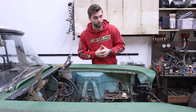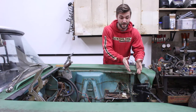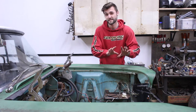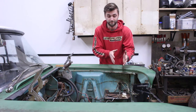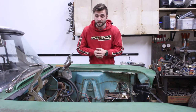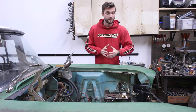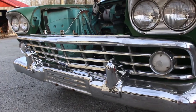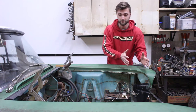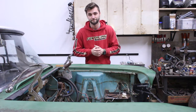We also have to run an intercooler because we don't trust doing burnouts in this thing with no intercooler. So we've got to try to get the intercooler as close as possible to the front of the grille, then get a radiator in without hitting the balancer on the 12-valve. We're going to run electric fans on the side so we can bring the radiator as close to the front of the motor as possible. On the backside we need clearance where the original heater core was. We were hoping not to cut the firewall, but initial mock-ups suggest we're going to have to. Luckily this car has a peaked front grille and the hood comes down far over the nose, which allows us to move the intercooler forward as far as possible to minimize how much we need to cut the firewall and tunnel.